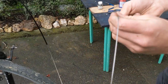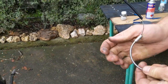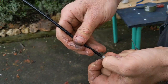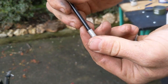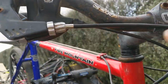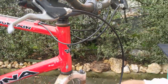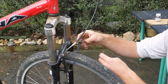So where I was going with that is that when you are putting these in, you've got to make sure that everything — if you zoom in here — you want everything to be snug and nice like that. You don't want to be having it out of position and then tightening up the brakes because you are going to break things and it's not going to adjust. So it's very important when you are doing all of this — up at the brake here — make sure that everything is sitting in nicely before you adjust it, because that can be one of the most common issues for having problems with adjusting, and also for breaking the housing.